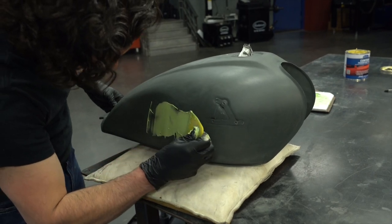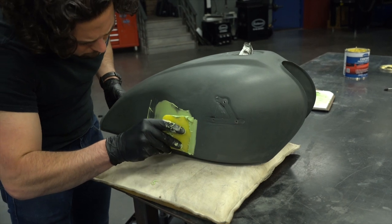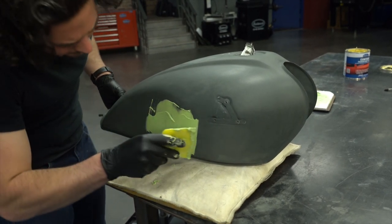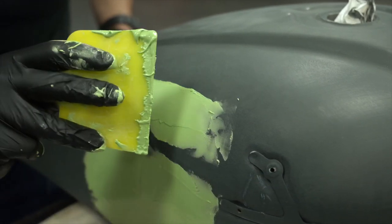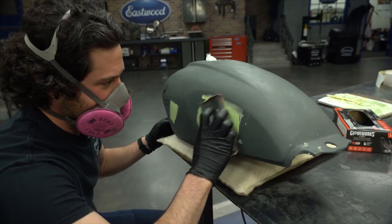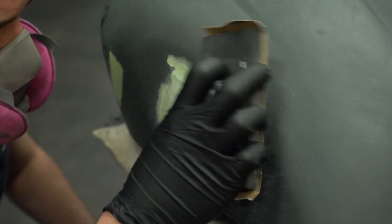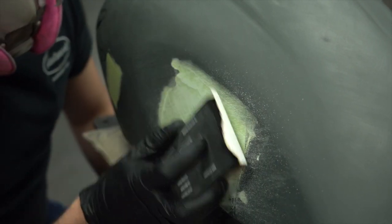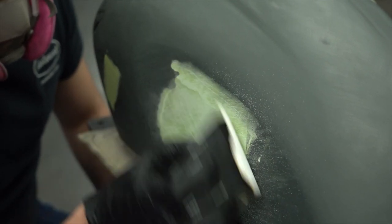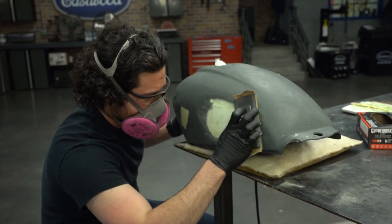We were lucky — we only had about three spots on this tank that we had to fill. On the left side there was that spot where your knee went; on the right side it was kind of on that body line; and then there was one spot a little more forward — a very, very tiny dent — we just covered that up with a little bit of filler. Your body filler is going to dry depending on your environment in 10 to 20 minutes. Then you can go back, start with a lower grit — in this case JD started with about a 40 or 80 grit — knock down the big chunks, and then start moving up in your grits as you go.